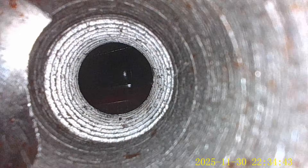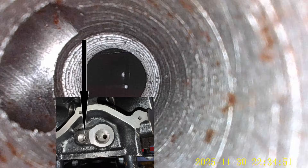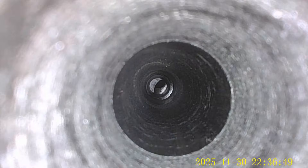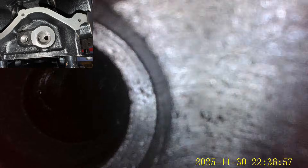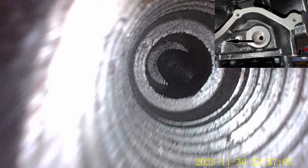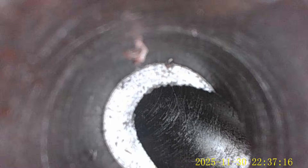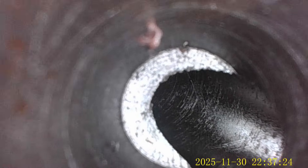Now we're coming on this side — this is the left side of the lifter galley and you can see there where it goes up to the top. So there's the back of the block. If you look down there, right there — that is the one that's coming from the main galley. This has got two ports in it. The one on this side right here feeds this and does the same thing — it goes down and feeds the left side lifter bore. You can see you need to grind that out — you can't have that big thing restricting flow like that. It's not even drilled perfect. You need to go through all of these with a bore scope. I've used it tons of times.